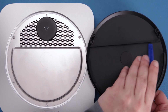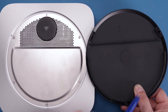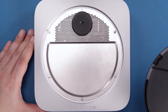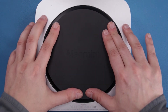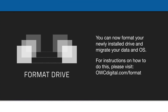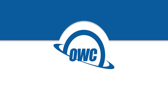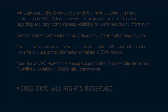On the underside of the bottom cover is a ridge that corresponds to this ridge in the antenna grate. These three sockets will grab onto these three posts. Flip the cover over and align the pins and sockets, then push the cover down to engage them. You can now flip your Mac Mini over, hook it up, and turn it on. Thank you.